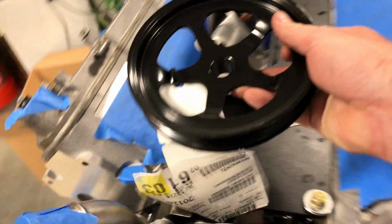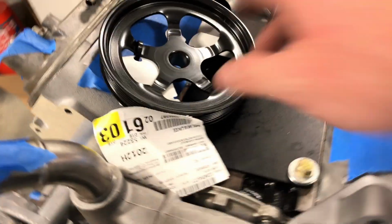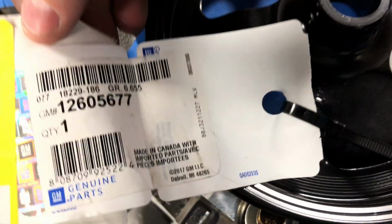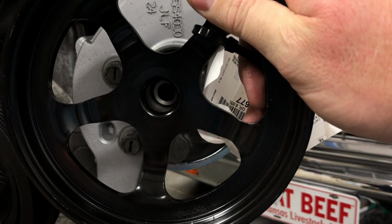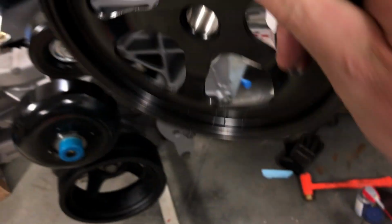And what I did here is I actually got this idea from another YouTuber, Gearhead for Life. For the life of me, drawing a blank on his name. I think this is from like a 2010 Tahoe, or I don't know. I don't remember exactly. Here's the part number here. I'll put a link in the description below, but it's pretty slick. So it actually has the cutouts in it, kind of like a normal sheave would be in my world. But for a normal pulley instead of the solid pulley, so that when you put it on here, see if I can do this. Maybe there we go. You can still access the bolts, which is a real novel idea. I don't know why GM hid those bolts behind a pulley, but this certainly makes it easier to service, take it on and off. So I'm going to put that on.